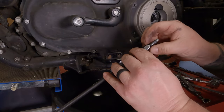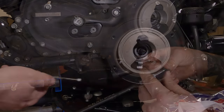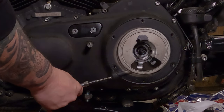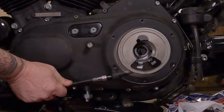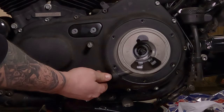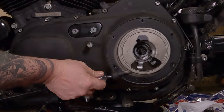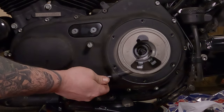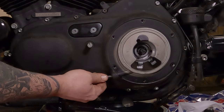It comes out just like that. You can just take this o-ring and pick it right up off of here. Now we have our new o-ring on our clutch cable. We're going to reinstall the clutch cable — thread it in here, being very very careful to make sure we do not cross-thread it. Try your darndest to make sure it threads in there straight, and because you're spinning the entire clutch cable this can be a bit tricky — have lots of patience with this.